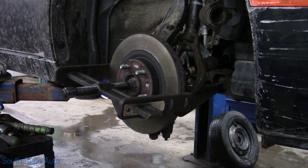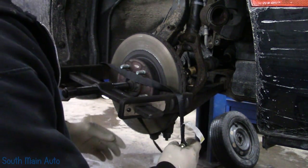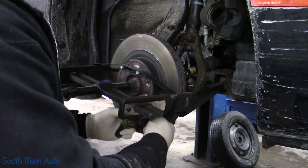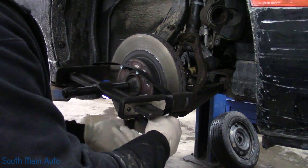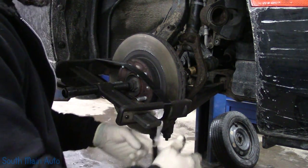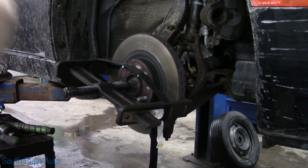Let me get the safety strap. I thought I'd just put a little bit of pressure on it - a little bit, stall out a half inch impact, flex the rotor dang near in half, and then just smack it with a little hammer and off she'd come. Not the case. Do not try that at home. So we'll engage the safety strap. This is the OTC 6980 rotor puller, I think I've showed it in other videos. I'm busting these babies out - that's how you know it's getting real around here.